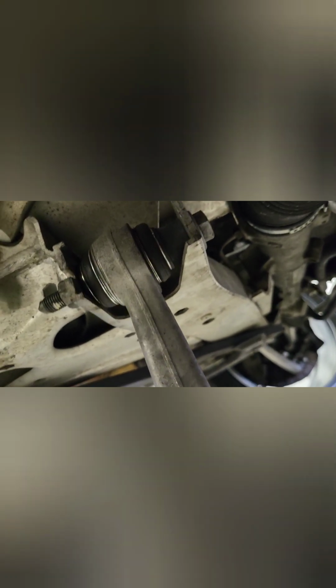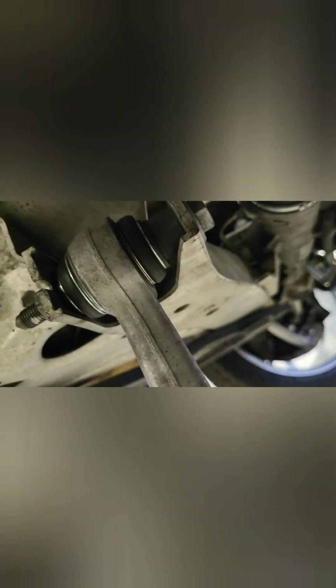We're back up at this thing. See if I can pick this up on the mic. Can you hear that? That's me just tugging on it. That's making a knocking sound. I'm guessing that's not normal. The bolt was torqued to spec. It's tight. There's no movement on the actual bolt. It is snug in the subframe. There is a knocking sound coming from this, and it's the same exact deal on the other side as well.